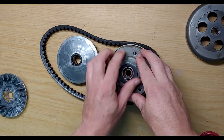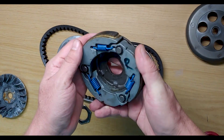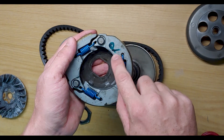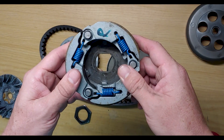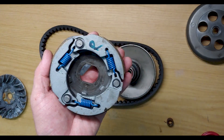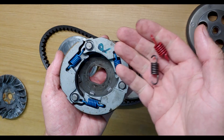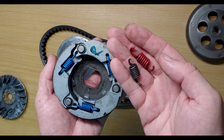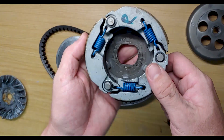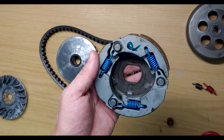There's more than one set of springs. On the reverse of this clutch assembly you can see three springs — those are 1000 RPM springs. The standard springs are these little ones here — those are 500 RPM springs. You pair those up with a 2000 RPM spring. The 2000 is what we run here because the centrifugal force required to make these shoes actually engage onto the clutch bell is much greater.